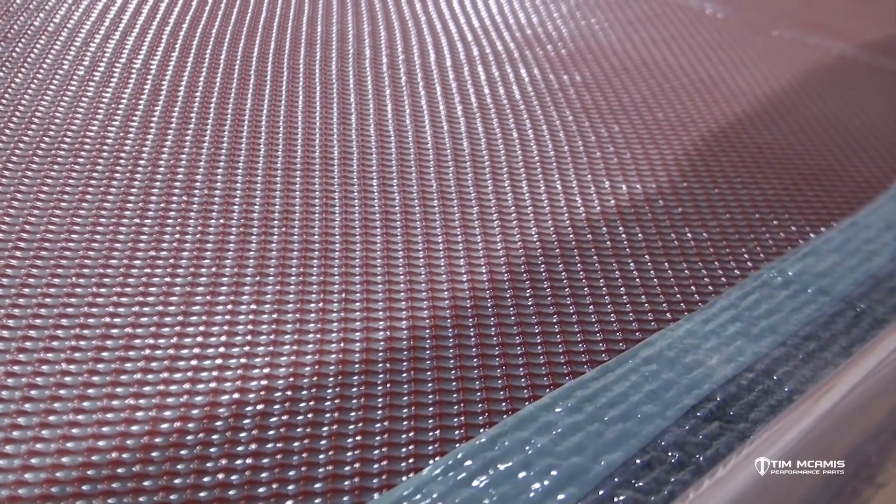It's hard on the exterior paint, hard on the gel coat under the paint, and hard on the resin. On a carbon body, you'll see a lot of print-through when it sits out in the sun too long. What that is, is the sun heating up the inner core of the material and imprinting back through the paint — so you'll see a little bit of that texture of the cloth material used to lay these up.